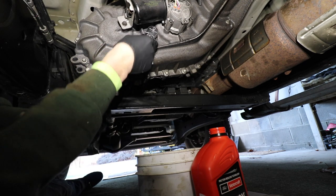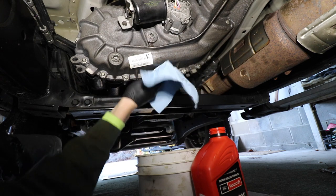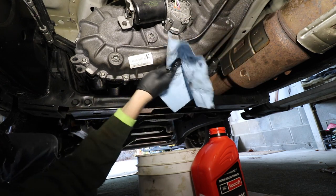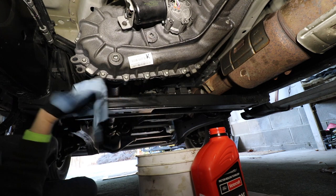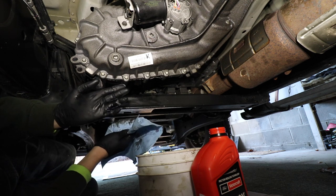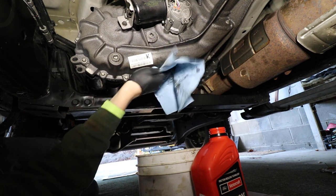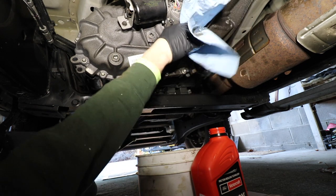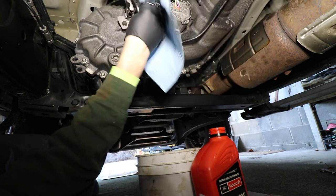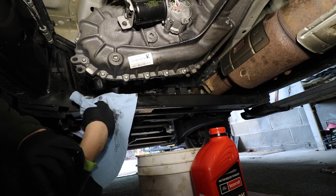If you want, you can clean up the leaky oil on your transfer case. However, I live in the northeast and I actually like to leave this oil on here — I'm not going to clean it off with brake parts cleaner. The only reason I would clean it is to check for a new leak or if there's a significant amount on the housing. This oil is actually a corrosion inhibitor, so I'm leaving it on. That's it for this job — I'm going to check the torque on those bolts later this week. Thanks for watching, and I'll see you on the next one.